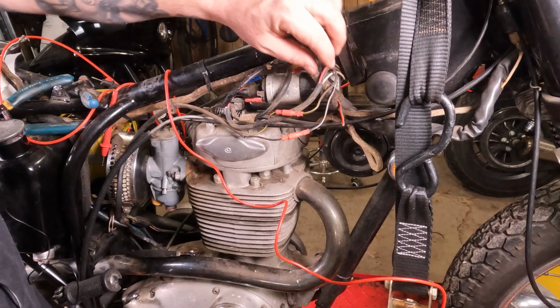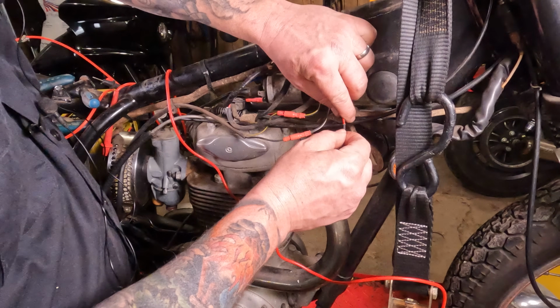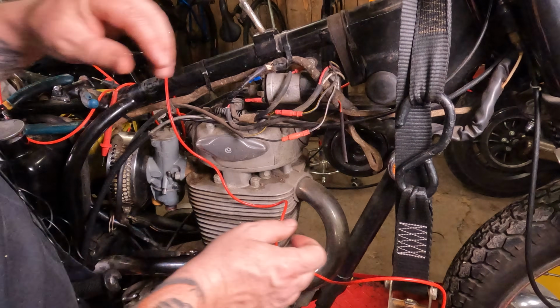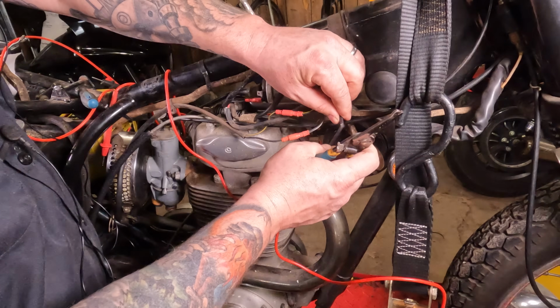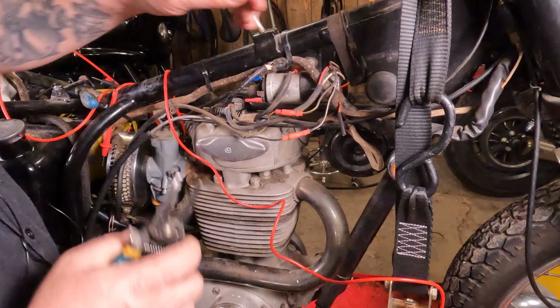All right, here's your electrical work tech tip for the day. Sometimes you got these weird dead-end wires. I like to take some shrink tubing. Not that size. I like to take the smallest shrink tubing that fits over it. Slide over top there. Trim off your excess. Figure out where your excess is. Leave about 1/4 inch still on there sticking out.